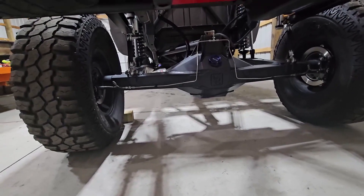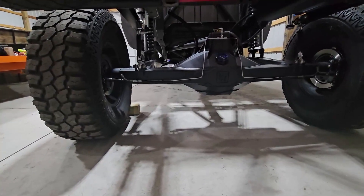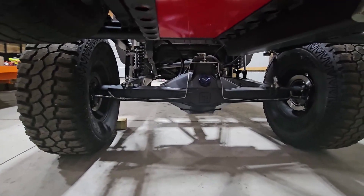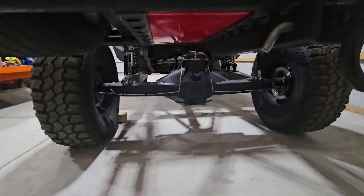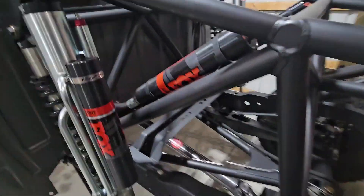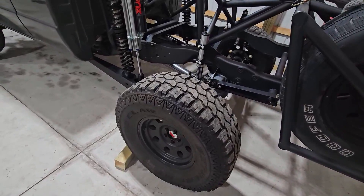The way we went about with this housing is it's future-proof. The internals of this housing are just your typical 9-inch with 35-axle splines. This housing can hold a 10-inch ring gear and 40 splines — basically the beefiest of beef you can put in these housings. We did just the typical 9-inch and the smaller axle shafts for cost, and because it still has the stock driveline — I doubt I'm going to hurt that axle with the stock driveline. It's got a spool in it, a new driveshaft, and it's got 35s on it — a metric 35 for the 16-inch wheels.